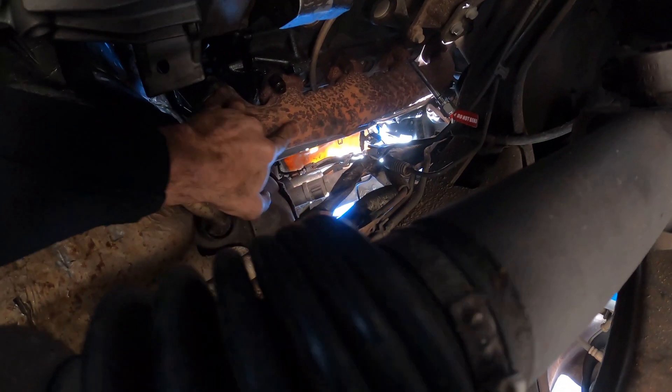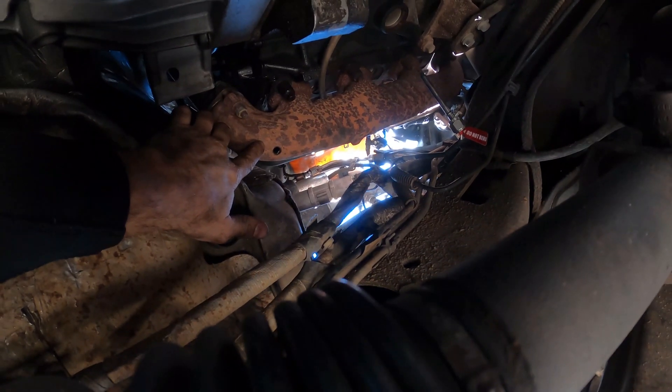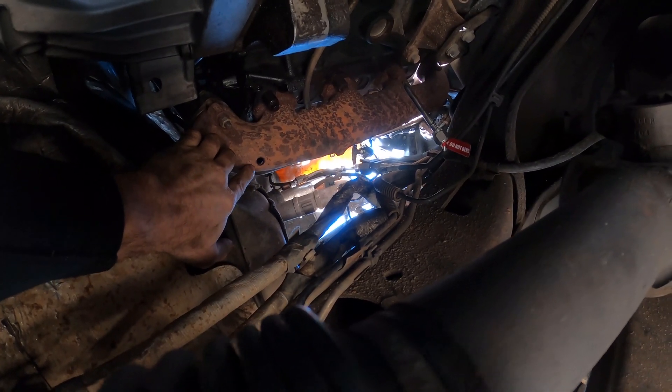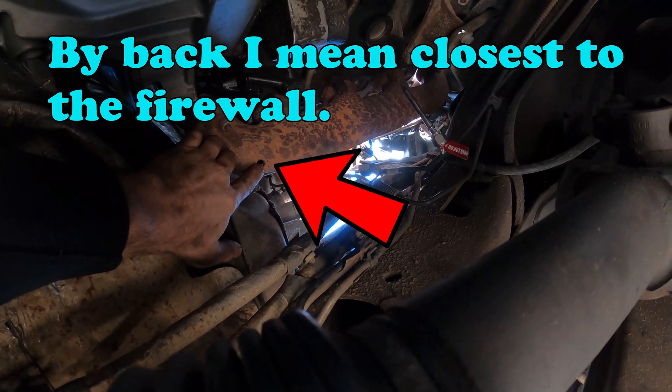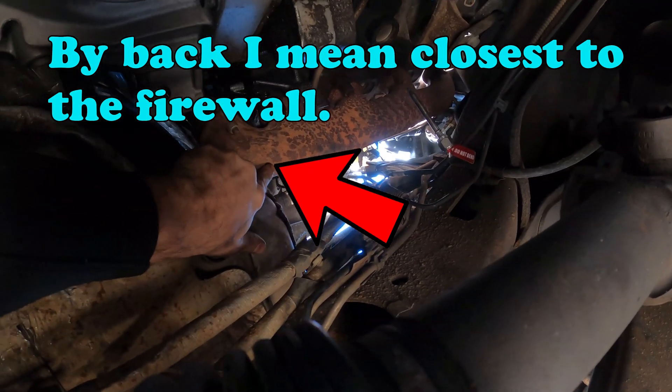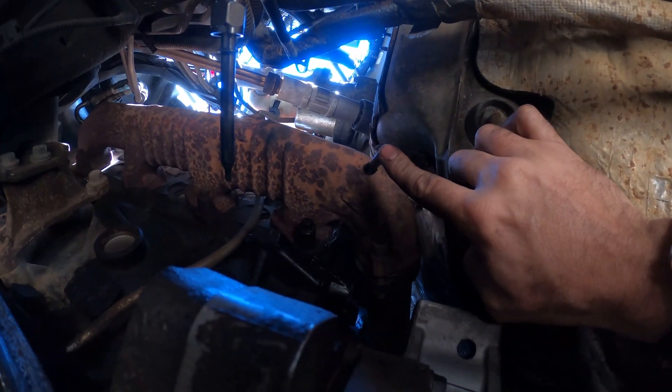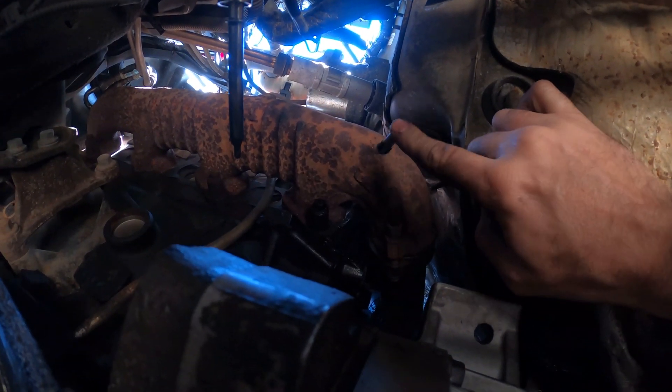It's going down to the driver's side header or manifold. Let me get into the truck and I'll show you what's next. So this is your manifold — this is what your exhaust rolls through. You're going to want to pick a spot at the back of it, right here, and drill your hole at the back of the manifold or the header. Then you want to lube your 1/8 inch NPT.